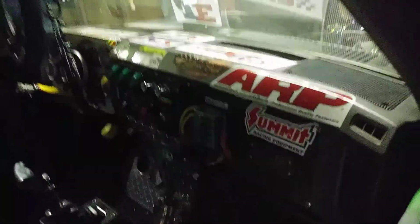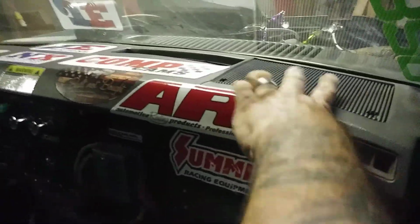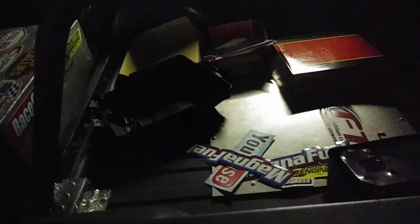We got to get the halo bar put in, the 2 down bars, which will go through the speaker grills. And I'm going to cut some aluminum plates for this so it looks nice and tight, because there ain't no speakers in there anymore. And I'll take them down and bring them through and tie them into where this bar goes through the floor right behind the cab mount and ties into the frame. So, but there's still stuff to do to this one yet, and probably going to put a wing on the back of it.